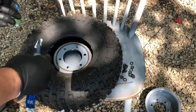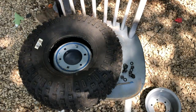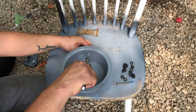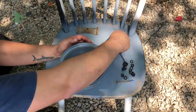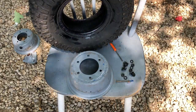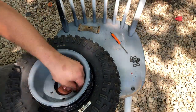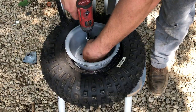We pulled half the rim out and got the o-ring and this fancy new blue sealant from the local parts store — a large blue o-ring that wasn't previously blue. I thought maybe a fancy aluminum 90-degree air fitting would work, but it did not. The valve stem hole was pretty buggered up so we fixed that. We used axle grease on everything because we're being serious about this, and applied axle grease on the tire too. I usually use dish soap but I really didn't want to screw with it anymore. We made sure everything is sealed and airtight as possible, since in my infinite wisdom I did not order new o-rings for these wheels.